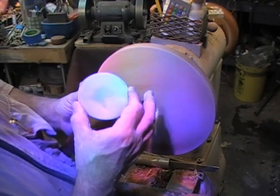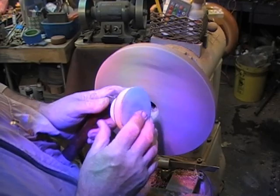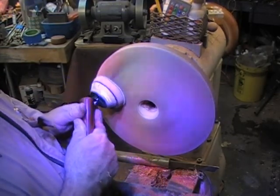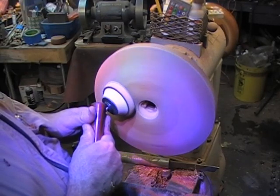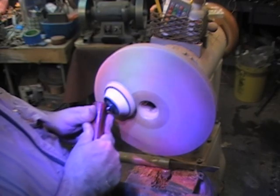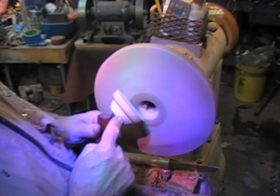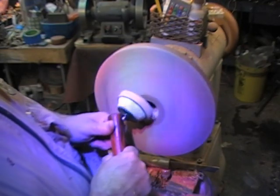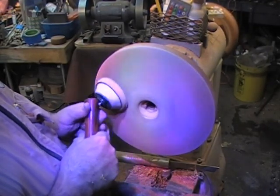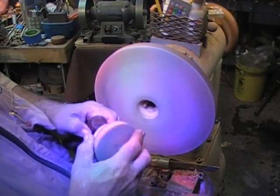Why? That fills the 3 3/8 inch dimension of the sanding pad. Also, this has got a different density than this does, and it conforms better to some of the sanding surfaces. That's a couple of reasons. The main reason I use it is it saves this pad that costs a couple of bucks more than this one. It saves it from being burned out and gone bad. So I use the interface pad.